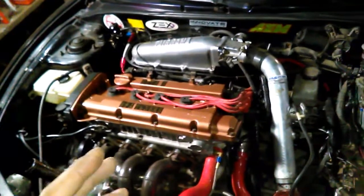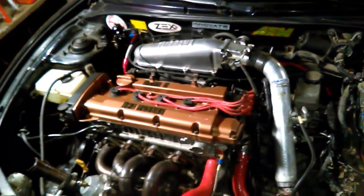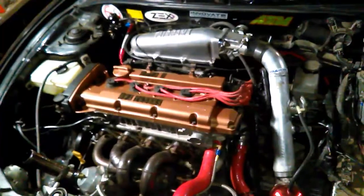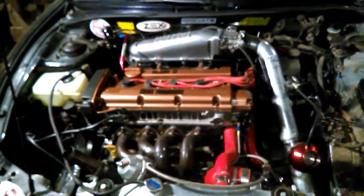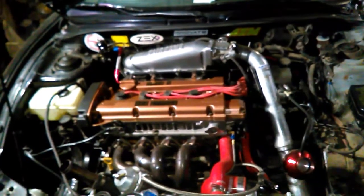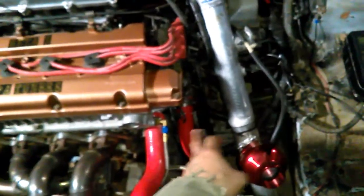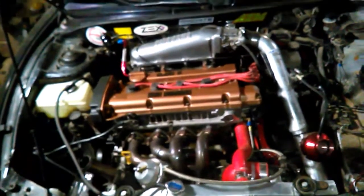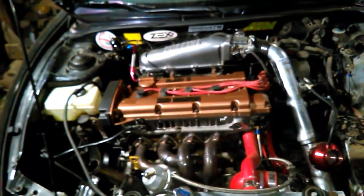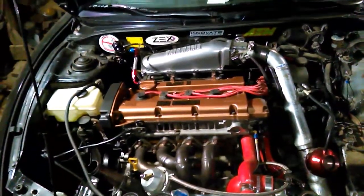They will settle in, so the next time I take this out to put the Beta 2 transmission in it should be a lot easier. I can tell a million difference - we've got shifter cables in these cars but the shifting is insanely a lot better, it's smoother, goes into third gear every time real easy. What happened is the car would come rearing up and bind everything in the transmission - it'd be harder to get into gear. It caused a lot of issues and it's a major difference.